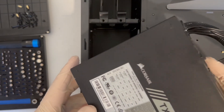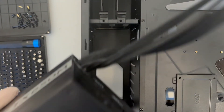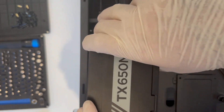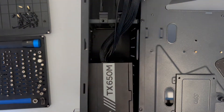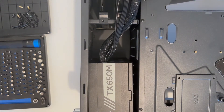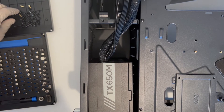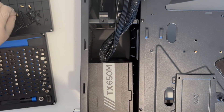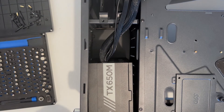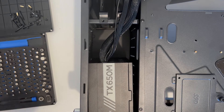The PSU goes in, and if you think that 650W is extreme overkill, then think again, because that 980Ti uses about 260W on full load with frequent spikes, so a robust power supply is a must. This is one of my favorite PSUs because it is semi-modular, very reliable, decently priced around 60 quid when on deal, and does not include the troublesome 0rpm mode that will inevitably break and turn the PSU into a howler.